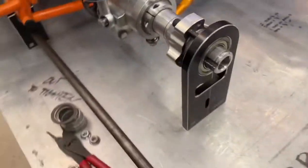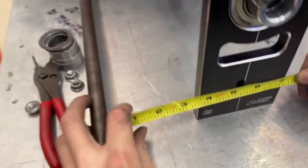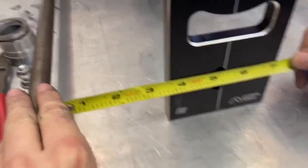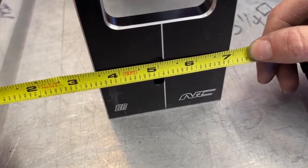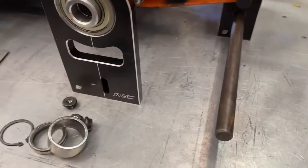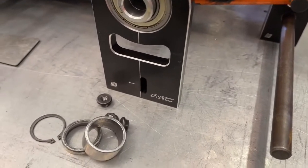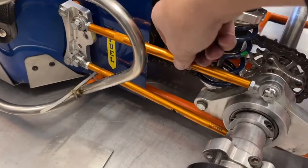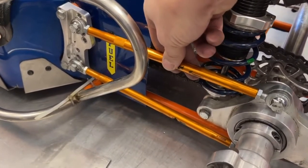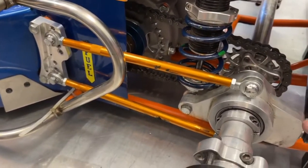The next thing we're going to do is grab the tape measure and check this measurement here. From this bar to the block, we have 5 and an 8th exactly. Now we're going to go to the other side of the car and measure from this point to here to get 5 and an 8th, to make sure that's equal. If that's not equal, then we have to start turning on these radius rods. If we turn them equally, it will drag the axle in or out. If you do it unequal, it will start to tilt the birdcage.